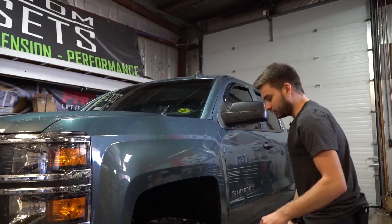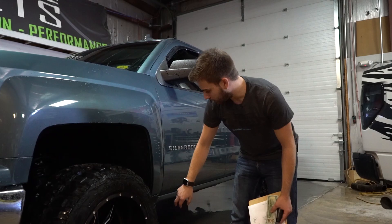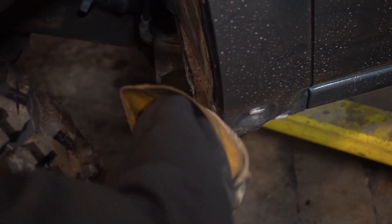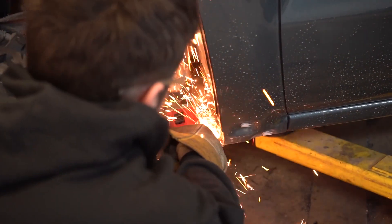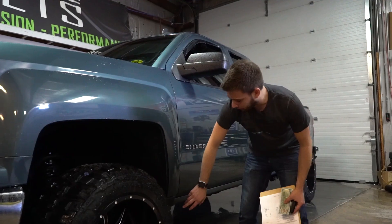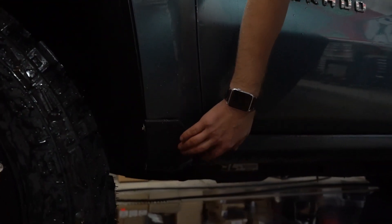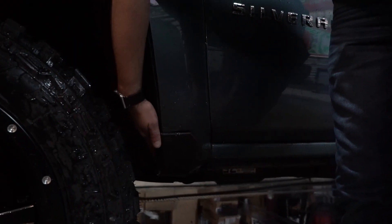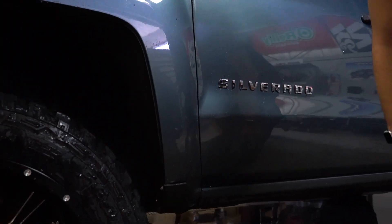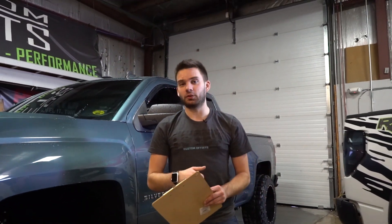We should talk about trimming — how we made these fit. In the front, it fits and clears just no problem on the 4 inch Fabtech. But in the back you still have to go in — it's not quite a full NorCal, but you still have to cut out some metal and smash it back, then take your inner liner and cut that. On the 14s and newer trucks, they have this plastic cap on the edge here that tends to get in the way of things. What Banker did is went in, heated it up, pushed it back and bent it in to reform it, then zipped in some screws to hold that all in place. That is how you fit your 33s on 20x12 negative 44s on your 14 and newer Silverados.